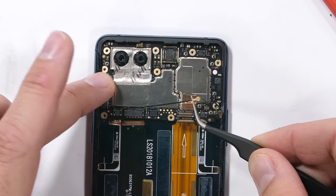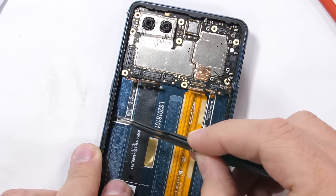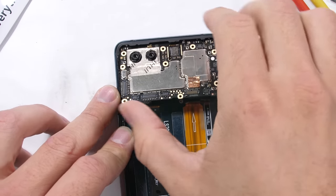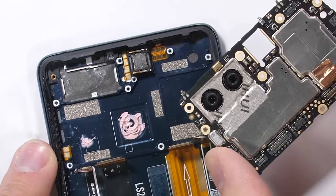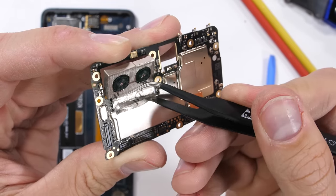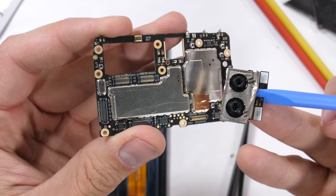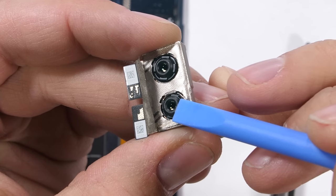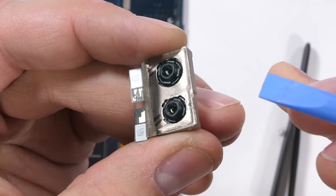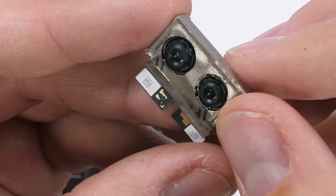Making our way back up to the top, we can see the ribbon path from both fingerprint scanners that plug into each side of the motherboard. The motherboard itself has one screw holding it in place by the little square earpiece speaker, and then the whole thing can pull away from the phone body, revealing its bubble-gum-like thermal paste that uses the aluminum frame of the phone as a giant heat sink. The rear camera connectors are hidden under metallic tape. The Nubia X has 16-megapixel and 24-megapixel cameras — no wide-angle or telephoto lenses, just portrait mode. Neither of the lenses have optical image stabilization. These dual cameras also double as the front-facing selfie cameras when the rear screen is activated. Pretty unique.